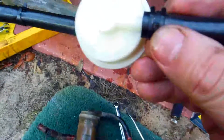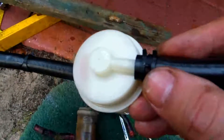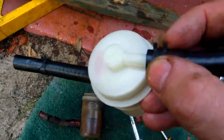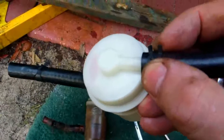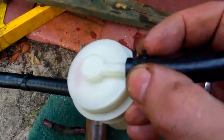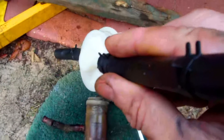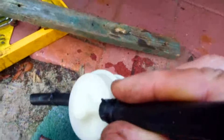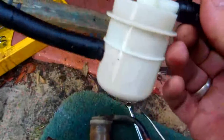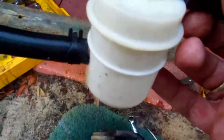Here's an interesting tidbit about these spring clamps: back in the 1960s, Chrysler Mopar was noted for engineering and used these same style clamps because they apply constant tension. If the hose gets softer over time, the spring clamp tensions up automatically. With screw-on clamps, you'd have to manually tighten them with a screwdriver as the hose softens. I also put a little Marvel Mystery Oil in the filter so it'll run through the engine on first startup.